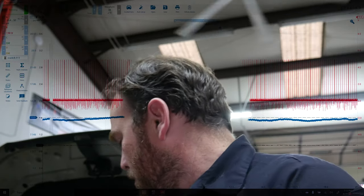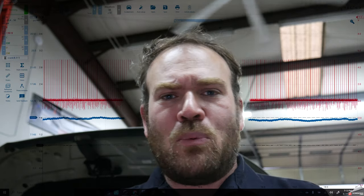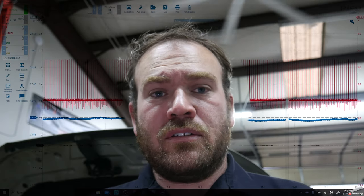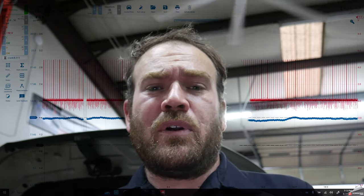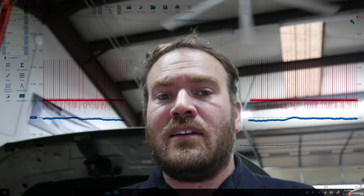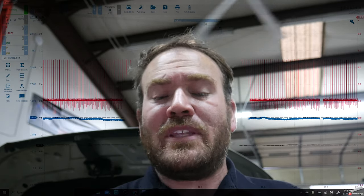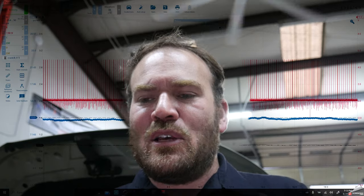How can we prove that? I could mount an oil pressure sensor inside the crankcase and run a wire to it, but there are no ports and that'd be very difficult. Or I could unhook my gauge, open up the vacuum leak, and see if oil pressure instantly jumps up. We can also do a little math: 10 inches of vacuum is around negative 5 psi — normally about half as much psi. So if I keep the same RPM with the vacuum gauge unhooked, should I jump up 5 psi of oil pressure? That still doesn't get me to the minimum of 17, but it gets me a lot closer. Let's unhook the vacuum gauge and see what our oil pressure does.